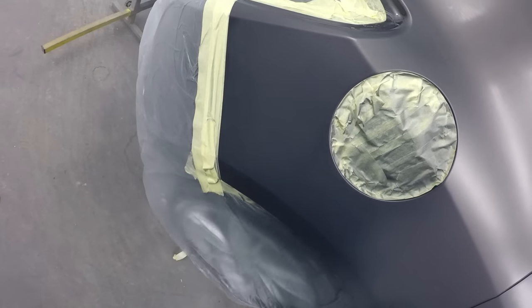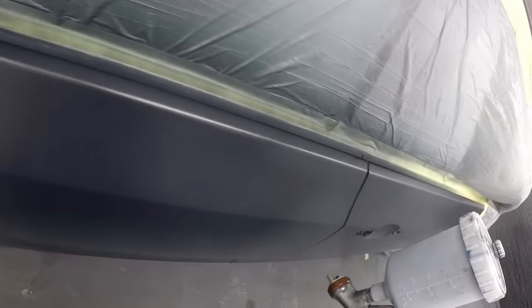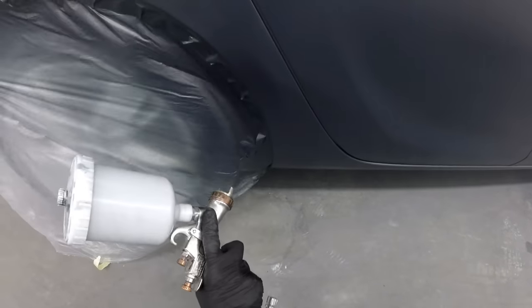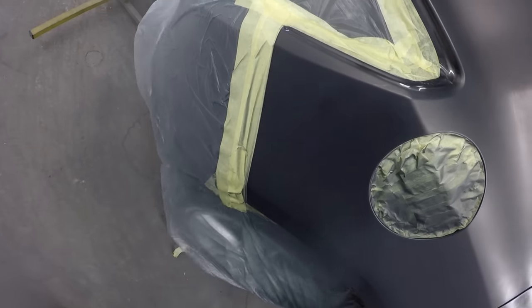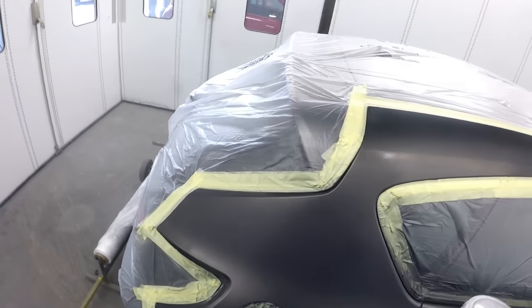I put down my two coats and my blending effect coat, but as I was tacking off this door I really was not too happy with it. So I just went over the blend areas again, just to try and feather that blend out a little bit further. The colour match was really good and I could have almost done this car edge to edge, the colour was that good — but no matter how much I tried to feather this colour out and tickle it at the ends, it was not having it at all.